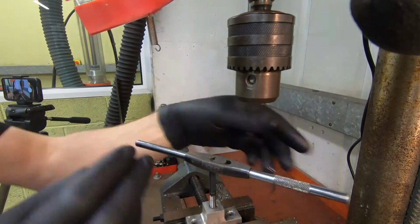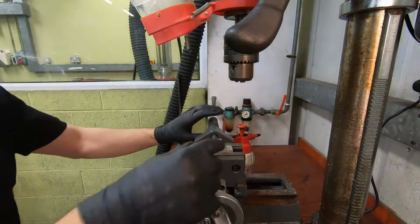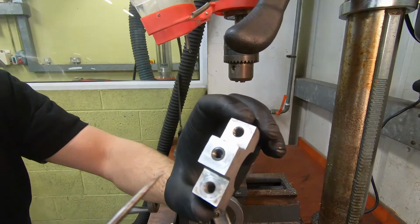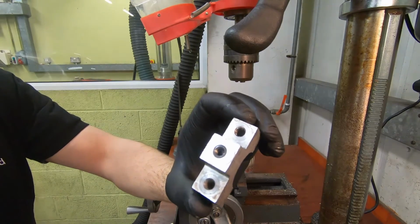As you screw the former further in, it expands out the lower section of the insert, giving a tight friction lock on the threads in the cam carrier. Once this is done, the repair is complete, and is actually stronger than the original aluminium alloy thread.